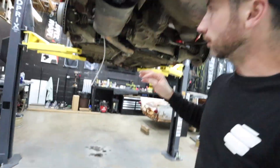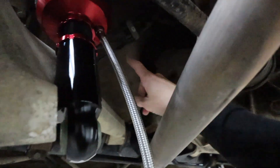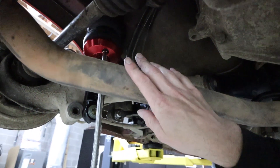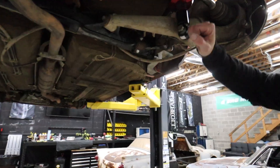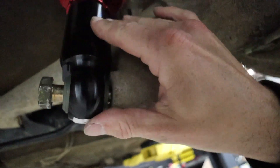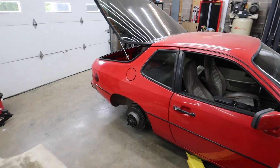I put the exhaust back in simply because I wanted to know exactly where my space allowance was going to be for the rear bags as I get the leader lines plumbed in. I wanted to know where I could run my lines without hitting spinning or articulating components like the trailing arm going up and down — because this space gets significantly tighter when it airs down — and also wanted to keep everything away from heat components like the exhaust. Now that the exhaust is back in, I'm getting the rear strut bags out and back in for the last time. I'm going to run some spacing on the lower bolt since it bottoms out before the shock is tight, and space it away from the trailing arm a bit. The top eyelet also doesn't quite fit snug in that cage, so I'll put a little spacing there too.